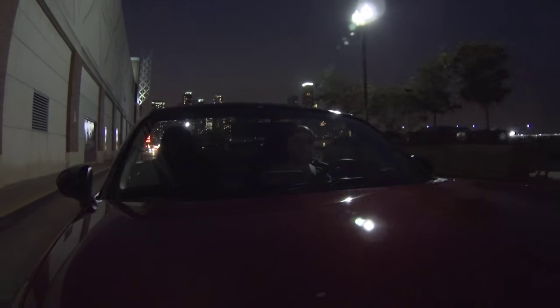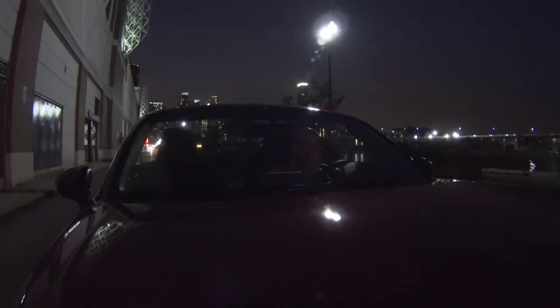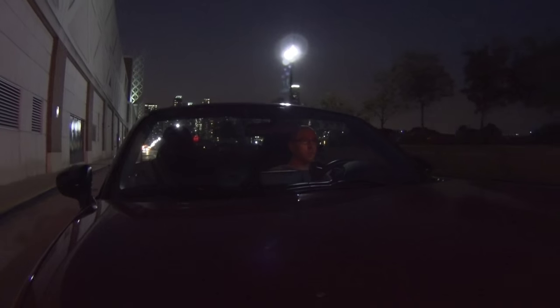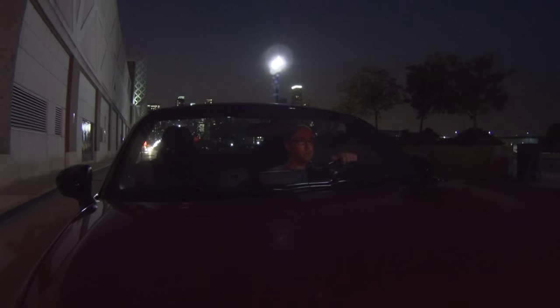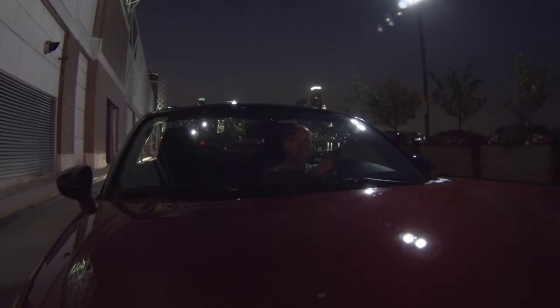The screen size is fixed by the distance it is from your eyes and the size of the font we need to use so you recognize what's on the screen in the shortest possible time. We didn't want to scale it down to fit the car because the physics of what you're doing — the distance from your eyes — isn't really different. We don't want to sacrifice your glance time, especially now we're dealing with the potential for more glare from being in an open-top car. All those basic human factors that drove it to the size and shape it was in the first place kind of forced it to stay that size.